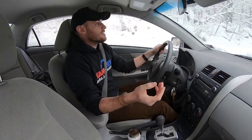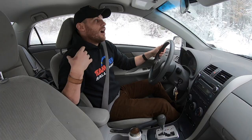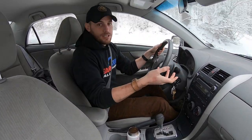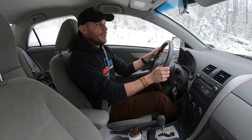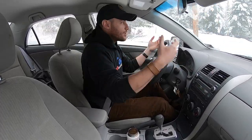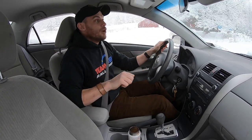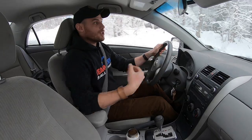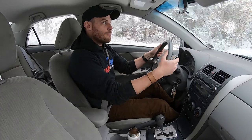A normal street car like this is set up with probably 70% front brake and 30% rear brake. That's so that on pavement, when you brake aggressively and all the weight transfers to the front, you've got 70% of grip on the front and only 30% in the back. The problem is that here on the snow at 40 miles an hour when you get on the brakes, no weight transfers — not enough grip for the weight to shift onto the front much at all. On snow, you'd want to dial in more rear brake, because you're not shifting that weight and you can use those rear brakes a lot more effectively.